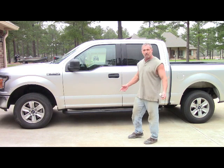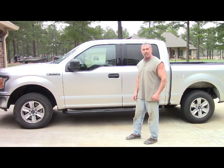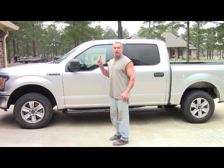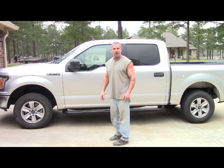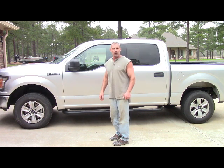Next thing is probably bigger tires. Off to the alignment shop to get aligned. Also make sure you readjust your headlights because they're pointing higher now — you'll need to angle them down a little bit so you're not blinding people down the road. Hope you all enjoyed it, and feel free to comment on the video. Thanks.